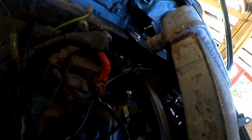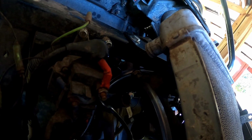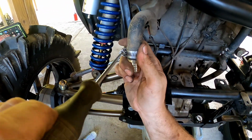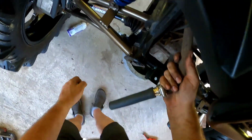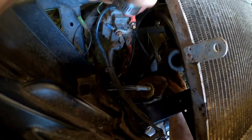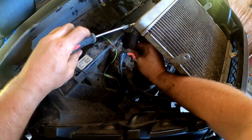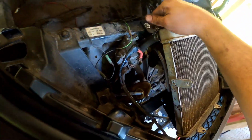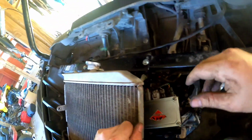I definitely recommend it. I don't know, unless mine's different, like a 19's different than an older model. My hose was definitely not long enough to fit this upper radiator hose. So let's go ahead and cut another piece and get this attached. I put in the 1-inch barb hose fitting here. I'm just going to tighten this up. That you just cut. All right. Grab my third and final coupler right there. Slide this down. All right, that's tight. So vent line, upper radiator hose, lower radiator hose, everything's mounted.